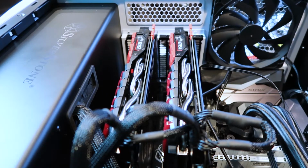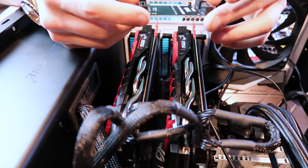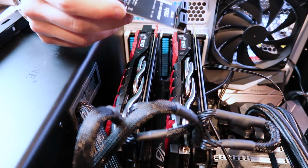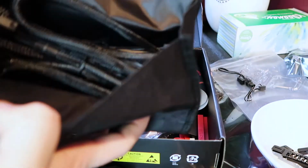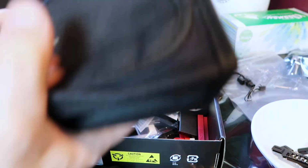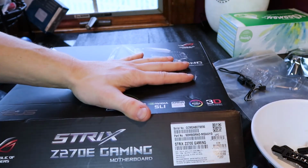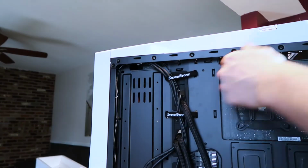That's that. Now the motherboard should have came with one of these bridges. We're going to connect this right here. Alright, so we take all this safety stuff off. You now have 2 graphics cards completely in sync. Now you probably have a lot of leftover cables and whatnot, but that's okay. Just find a box you want to keep and close it. Keep everything in there that you didn't use. Now that everything's connected, let's put your lid back on.